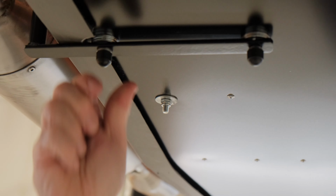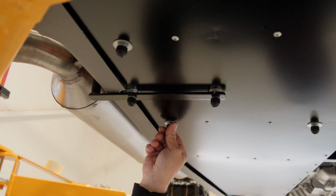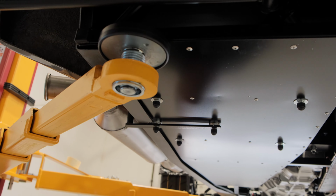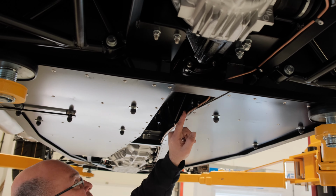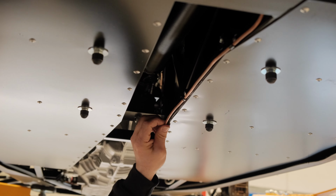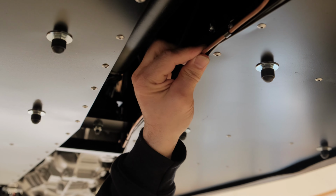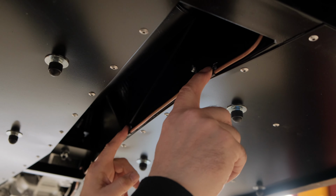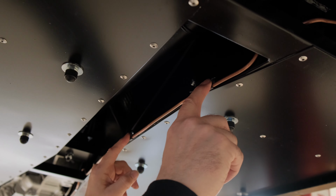They will check that at IVA to make sure you've got at least a thread and a half plus on that side, and we put the covers on just to make it neat and tidy. Brake lines coming through here, which you wouldn't have seen before, making sure that there's no interference or chafing or looseness, and making sure that these are within, well, we say 200, maximum's 300, but we will allow between 150